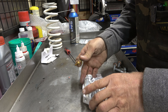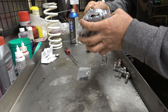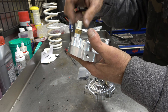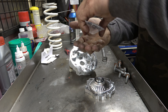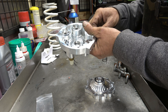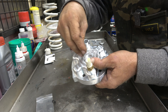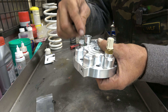This o-ring is still good - this bike really doesn't have very many hours on it, so we're going to reuse that o-ring. I'm not going to chuck this up in the soft jaws - I don't want to mar anything - but when I get this tightened down and all the bolts tightened down I can torque that a little bit more to make sure it doesn't come loose. Now I'm going to take these o-rings that the head comes with and put them down in these little grooves. What I learned from one of you guys: put a spark plug in here first - that helps hold this on as we set it on so it doesn't drop, because if it drops those o-rings can get out of place and you'll leak coolant into the head.